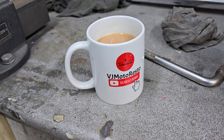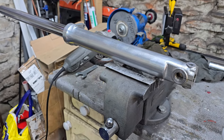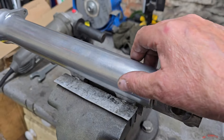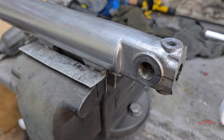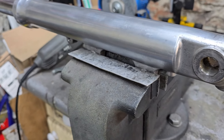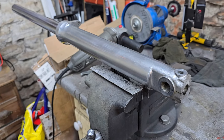We're back in the workshop and I've got the first fork leg clamped in the vice with aluminium soft jaws to protect the fork. It's best not to clamp it around the lower fork leg itself because you could easily damage it - clamp it on the caliper fixings, that's the best thing to do. Most of these forks come apart in roughly the same way.